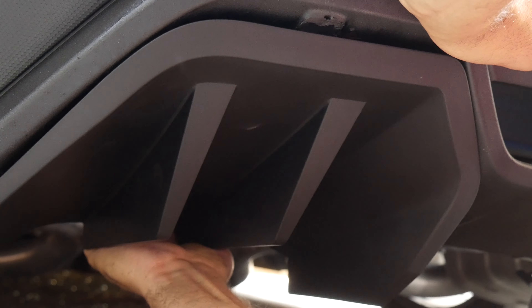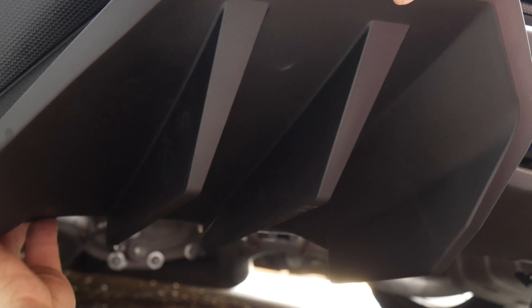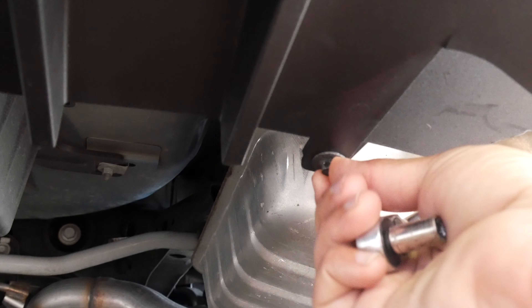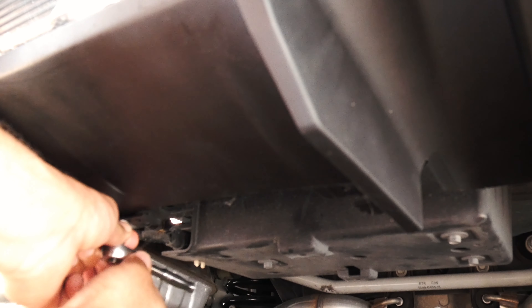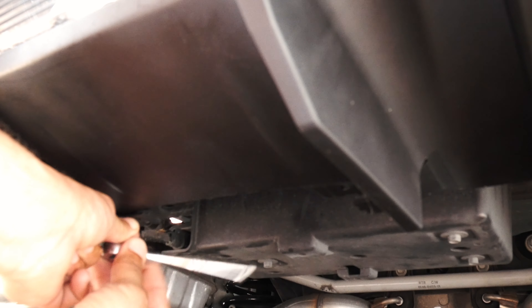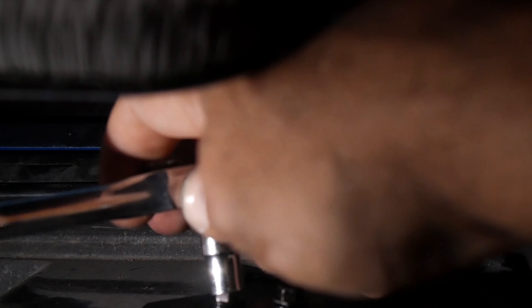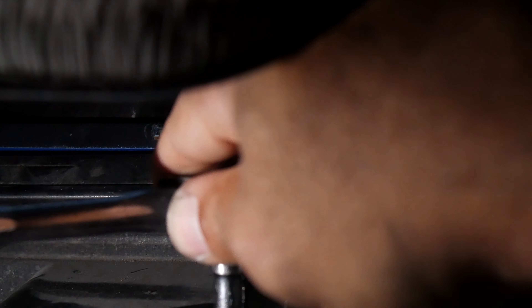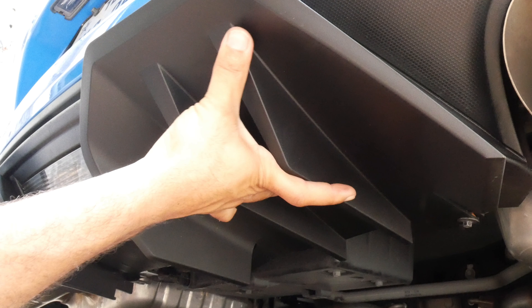Slide the diffuser up from the bottom capturing the rear valance with the bracket. Hold the adhesive surface away from the valance until properly aligned — you will not press the adhesive until the screws have been installed. Reinstall the OEM 7mm screws into the outside position near the exhaust tip. Install the 5mm long screw into the inner position towards the center line of the vehicle. Then tighten the 5mm short screws inside the valance on the left and right side. Do not over tighten. Press the double-sided tape against the rear valance to complete the installation and this vehicle is ready to rock.